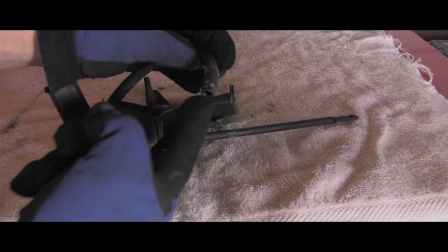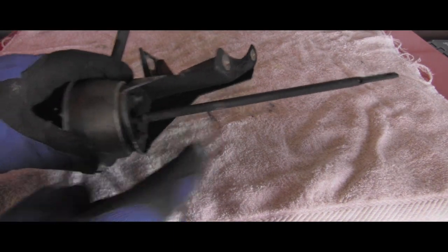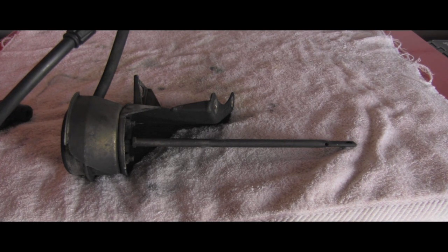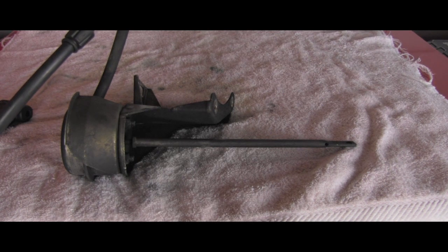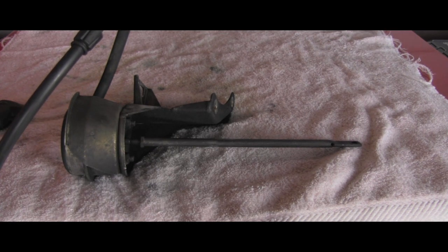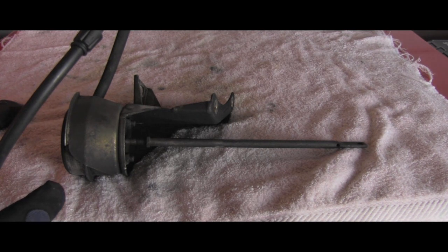To test this unit, I need to apply pressure right here and see if the rod will start coming out. I was able to hook it to my bicycle pump, so let's see if the rod will extend. And you can see it's perfectly working. I don't have an accurate gauge here, but it tells me approximately 18 PSI — and pumping a little more, it's coming even further. Right now I have 20 PSI, but my goal was just to make sure it's moving, there's no leak, and there's no hole in that diaphragm inside. I can also see it's holding pressure with no leaks. That's all I can test right now, and I'm happy with those results from this simple test.